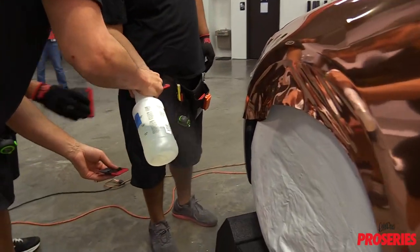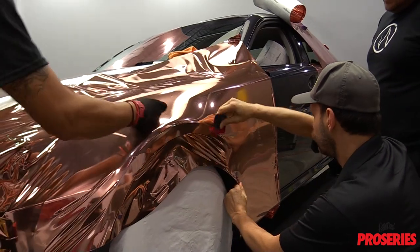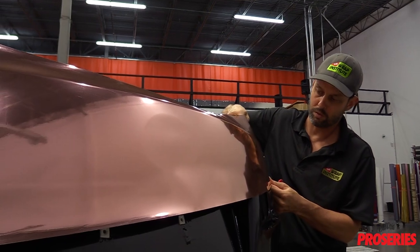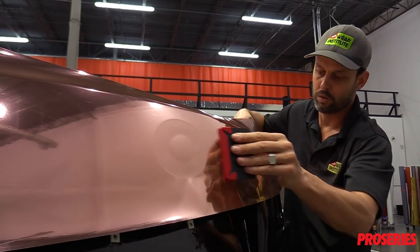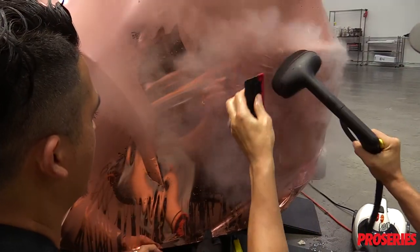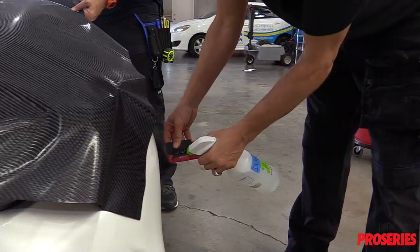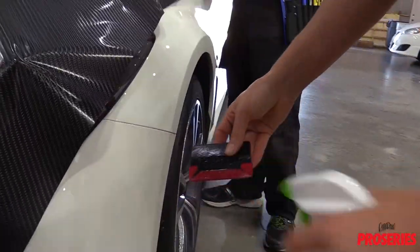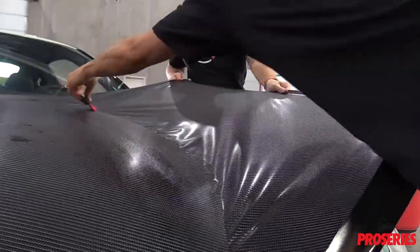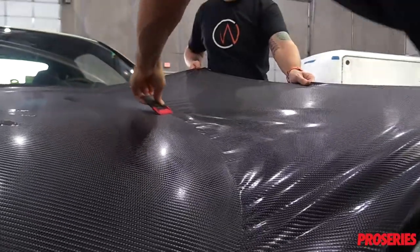The wing tip Pro Buffer is ideal for use on films that have a sensitive face, like unlaminated chrome. Once the film is set, the Pro Buffer is loaded with the glide solution and the installers can squeegee with firm overlapping squeegee strokes. With the wing tips protecting the corners, installers can use a wide variety of strokes at different angles and not worry about scratches or adhesive streaks. The Pro Buffer can even use the moisture from steamers to maintain the glide on the surface. Once the Pro Buffer starts to drag, simply spray both sides to load it again and then continue the install. Here are the Pro Buffers safely applying gloss carbon — the thinness of the edge and the wing tips allow installers to work farther without heat and the sensitive face of the carbon remains scratch free.